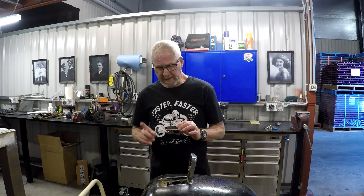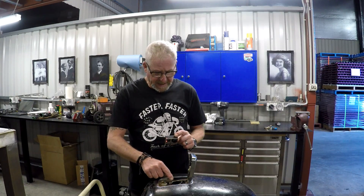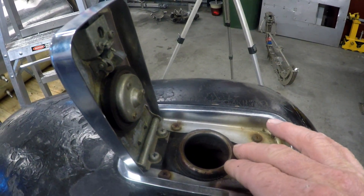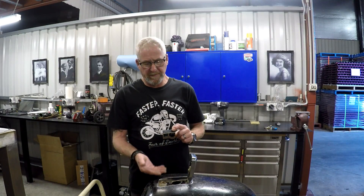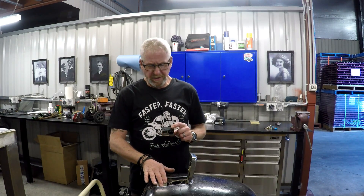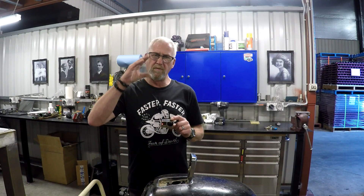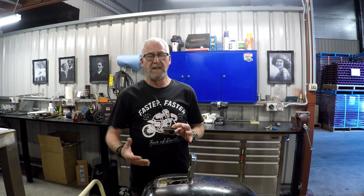So what I'm thinking about doing here — I've got a couple of options. What I'm thinking is cutting a disc and welding it over the top of the existing fuel filler neck. Then I can weld a panel in the top here and not have to worry about fuel vapours getting to it — I only have to make sure I've got this sealed. But I've got concerns about making sure I do the right thing in terms of treatment underneath that panel, and whether there will be any expansion and contraction issues doing it that way.